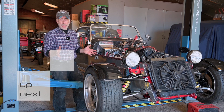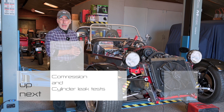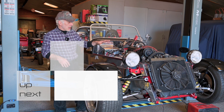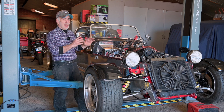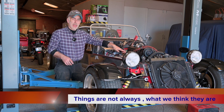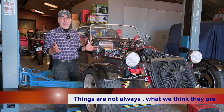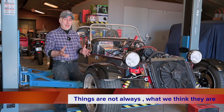Hi folks, welcome to the channel. I hope you're all safe with the coronavirus crisis and get through it in good health. I'm going to continue making videos. You might remember that about six months ago we started this Pinto engine up for the first time after it had been sitting for 15 years. We did a lot of checks, and one of them was checking the compression on the cylinders. We noticed the last two cylinders were a bit low — there was a big difference between the first two and the last two. In this video we're going to try to diagnose the cause of that lower compression.